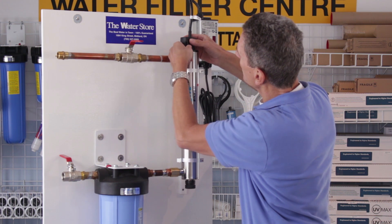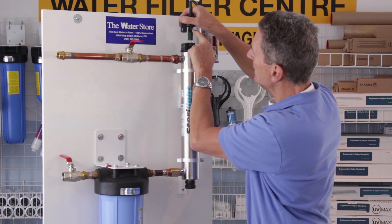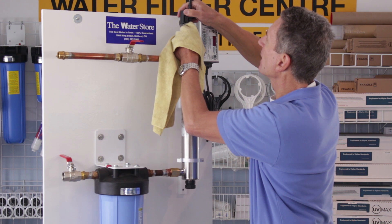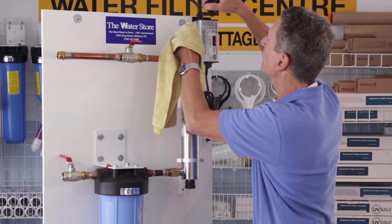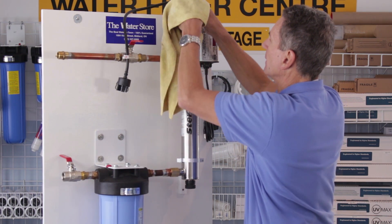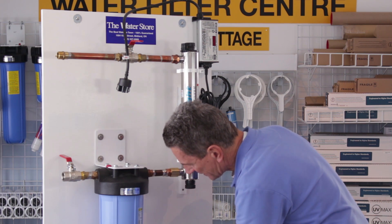Push the two clips on the side and wiggle it a little bit back and forth — that's going to release it. The bulb is attached to the underside of this connector. At this point you need to grab the bulb — use a rag or something like that because you don't want to touch the glass sleeve. The connector slides straight off; you just have to wiggle it ever so slightly back and forth to get it loose. Once you've got it loose, set it aside somewhere where it's not going to get wet and slide the bulb out. Make sure you don't mix up the old bulb with the new bulb because they look very similar.